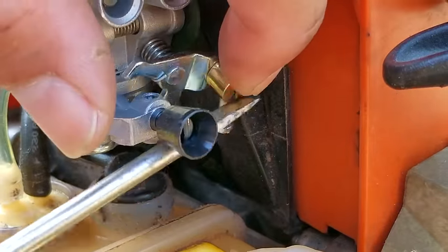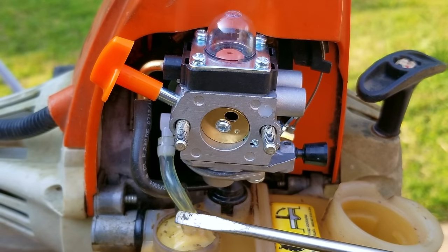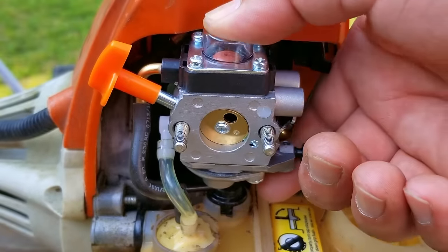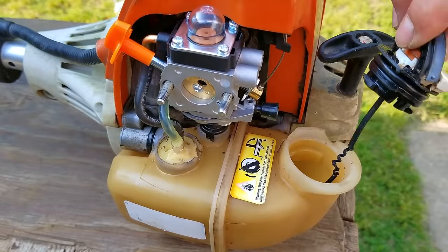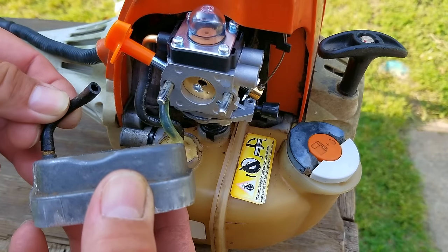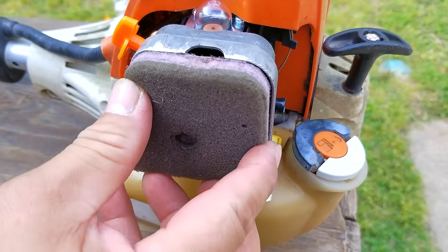After that, I just need to hook up the throttle cable, the fuel lines, and before I put the metal base back on, I need to confirm fuel flow. When pressing the purge bulb, fuel will flow up through the short fuel line and into the carb, fill up the bulb, and then go back to the tank through the longer fuel line. Fuel is flowing just like it's supposed to. If your fuel is not flowing like this, there could be an issue with your carb or your bulb. Also, if the bulb doesn't fill up at least partially with fuel, the engine is very unlikely to start. Remember to install the emissions hose back to the port on top of the fuel tank — if you don't, the engine could breathe in unfiltered air and cause it to wear out prematurely.